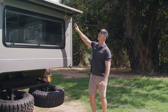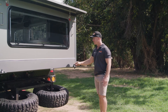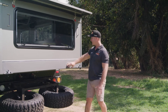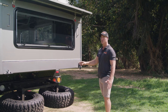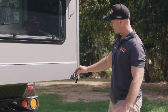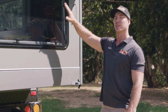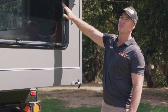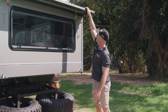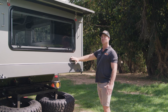If you have one of our fold-outs at the rear, there are a couple of locks that will need adjusting over time. This is quite a heavy section, so if you leave these and they get a bit loose and you haven't tightened them after a trip, that's a lot of weight up top that this little latch is holding onto. Make sure when it's up that you tension it so it's holding it nice and in place with no movement. Same with the rear — once that locks in, you want it to engage against the seal so it's not an entry point for dust or water.